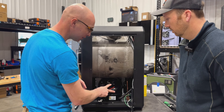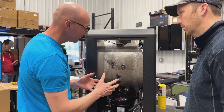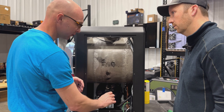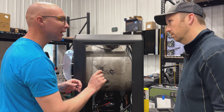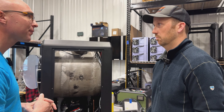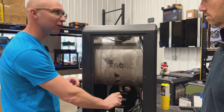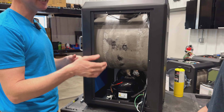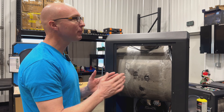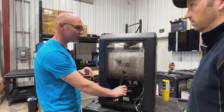Our system doesn't need recharging. We pinch off our refrigeration system, so there's no chance for a leak — that's what we've chosen to do, giving us a very small chance of leak. On other brands, there are Schrader valves left on, and every Schrader valve in the entire world leaks — period, full stop. If you have a Schrader valve, to prevent it from leaking you've got to change that gasket out about once a year or check on it every now and then.